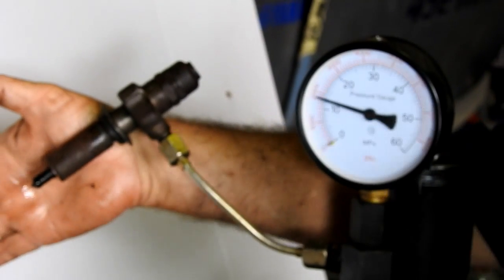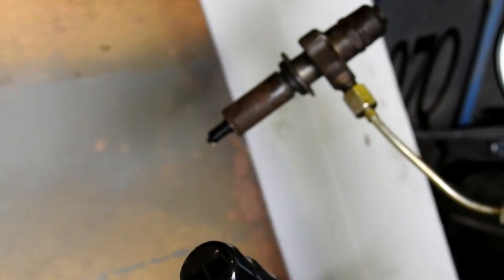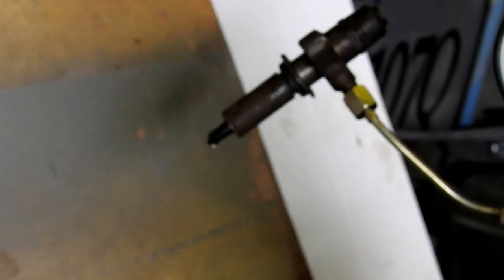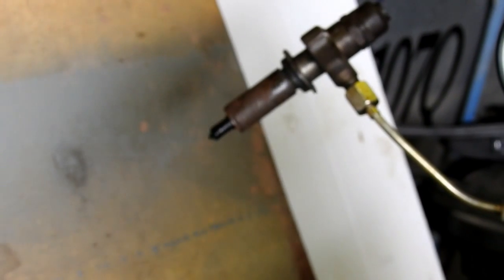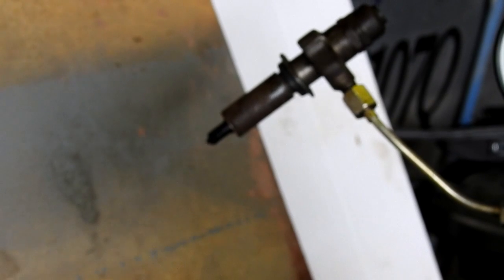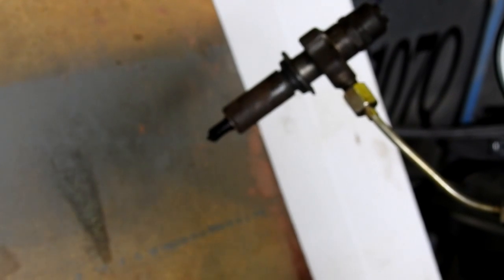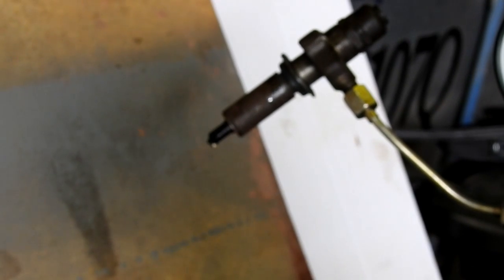Hopefully you can see it. I'll zoom in just on the injector tip - might try a piece of board behind to see if that makes a better picture. You can see where it squirts out - it's just a squirt, it's not atomisation at all, and it should actually chirp when we go down slow. So these injection nozzles are had it. That's exactly what you don't want to see. And when you hold a bit of pressure on you can see there's a drip forming - that means it's tip leakage as well.